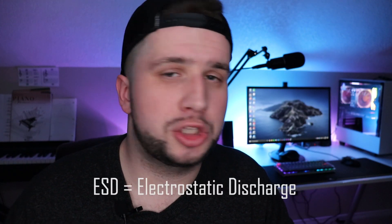A big part of the exam is also the safety portion — just when it comes to working with laptops or desktops, there are precautions you need to take regarding ESD and general handling of electronics. I actually learned a lot about electrostatic discharge. A lot of myths and preconceived notions — like ESD isn't even a problem anymore, or if you have ESD you'll know right away because a component won't work. That's not really true. Components can die six, eight, or ten months down the line randomly, and that could have been because of ESD. I've been building PCs for a long time and never took huge precautions, but after this program I'm going to start. With Apple hardware being very expensive, you really don't want to damage a logic board, because that's a very expensive replacement.